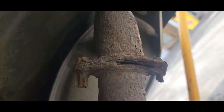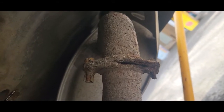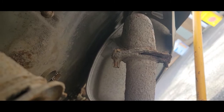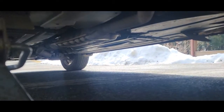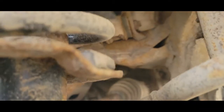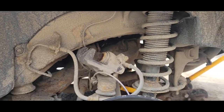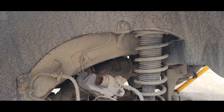I'm going to try to cut the pipe and put a two-inch pipe section in with a couple clamps, or weld around it. Otherwise the muffler is almost $200 and the front pipe goes all the way up — it's part of the converter. I think she's going to spend about $400 in parts, maybe a little more, and then we still have to get it out. I'm going to try the least expensive fix first, and if it works it may last the lifetime of the converter.